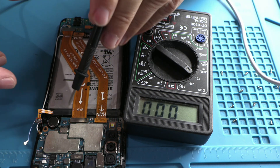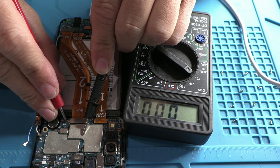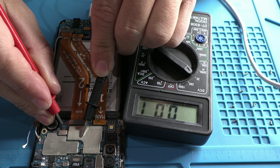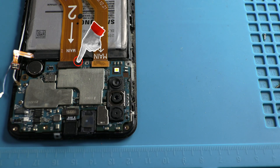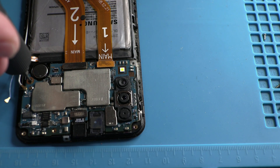If you're not getting 4 volts at the battery connector, there's your problem. The plastic connector is broken and doesn't transmit voltage to the motherboard. We've repaired hundreds of Samsung A-series devices, and the culprit is almost always the same — this plastic connector. It's designed to fail: it cracks, breaks, and loses connection with the motherboard over time.